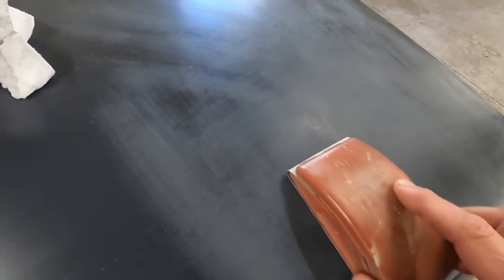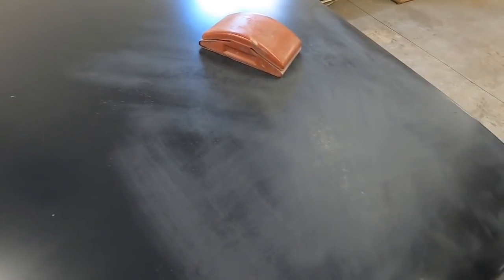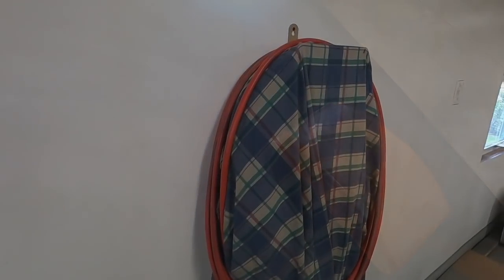The sealer has been drying for about three hours and it's sanding out pretty easy. I put some 400 on my rubber block and without even pushing down I'm just sliding it back and forth - you can see it's clearly sanding out. There are still a few little spots but I'll finish sanding those out. The first coat went on fine but the second one started spitting water out onto the paint.